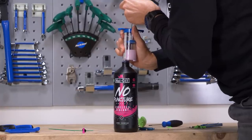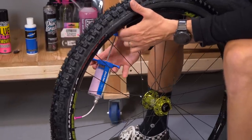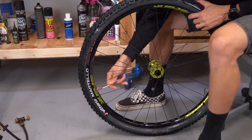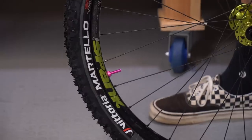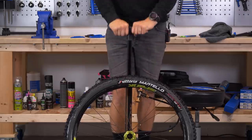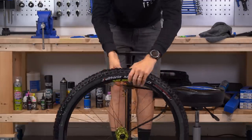The amount of sealant you use depends on your preferences — we're going to go for 70ml in this setup. This is the bit that can get messy. Inject the sealant in, then remove the syringe and wipe any residue that's come out, and get the valve core back in place. Take extreme caution if you're doing this anywhere that can't be cleaned up easily. You want to be doing this in a workshop, garage, or outside — avoid doing this inside, whether it's carpet or anything that can catch the spray, because tire sealant generally is quite nasty stuff on fabrics.